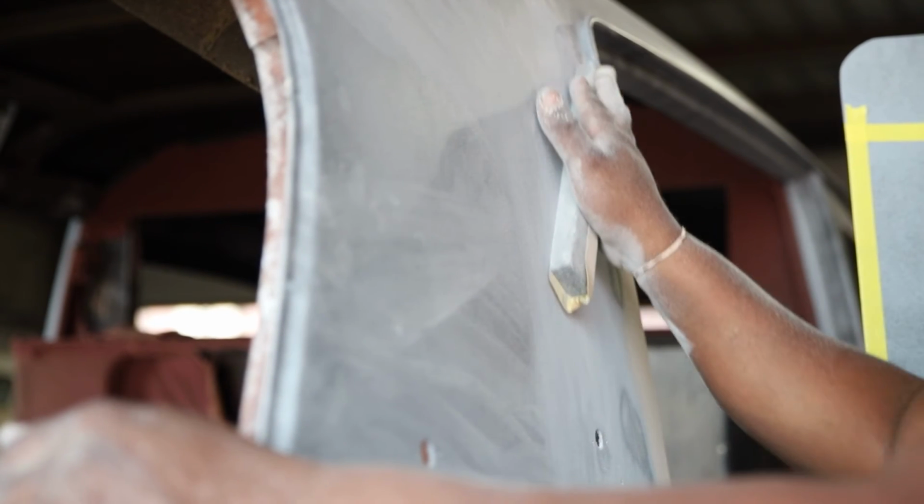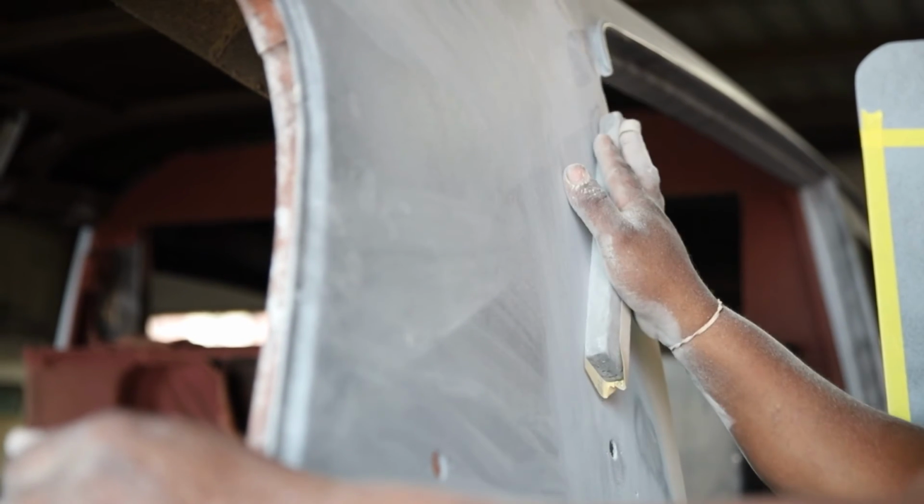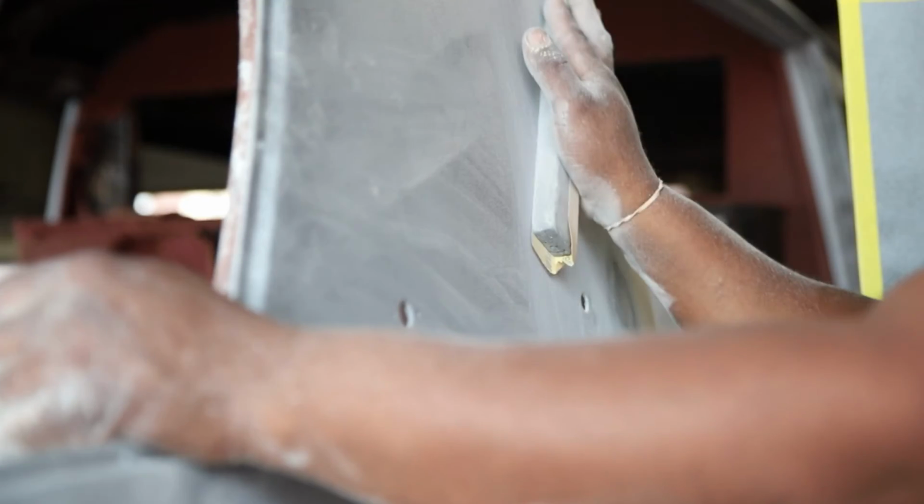And so when you break the car down in sections, let's say I was doing the driver's side door and I get finished guide coating and all I see is my primer there. I don't see my contrast color. I'm done. Well, maybe the driver's side door is giving me problems. Well, if that door is giving me problems, I'm not finished. But once it's done, there's no need to go back to it. Check it off. Look at the car in sections, and your goal is to complete each section of the car so that your contrast color is not there anymore.